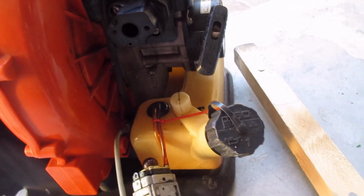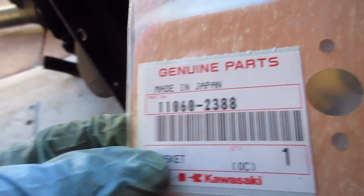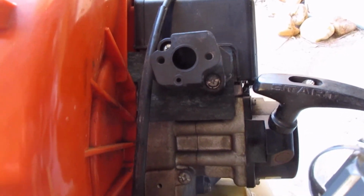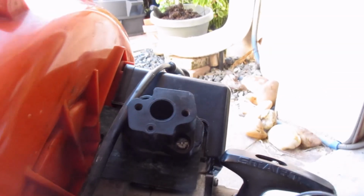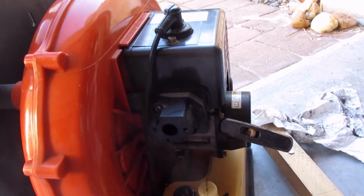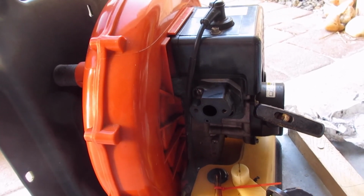But let's put a new one on. If the kid still has one, I'll have to buy another one if this one works well. This piston is really clean on this thing. Really nice shape. That gasket will fit. Last time I had an air bleed over here in the bottom. It was causing issues a while ago. It happens. If that gasket ever goes, I don't know. We need better gasket paper. It's not too hard making a gasket. It helps having a punch.